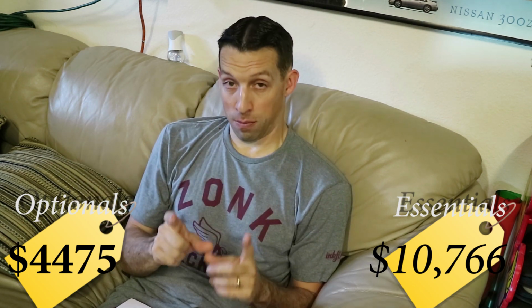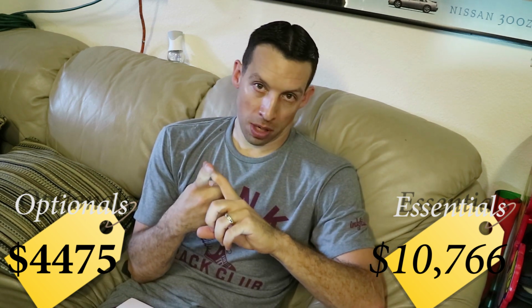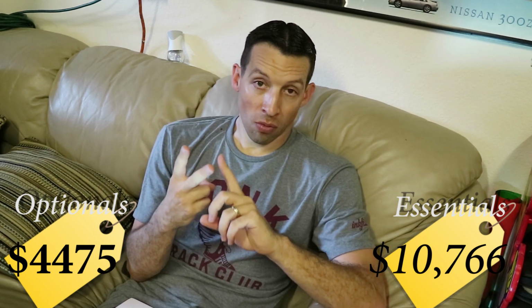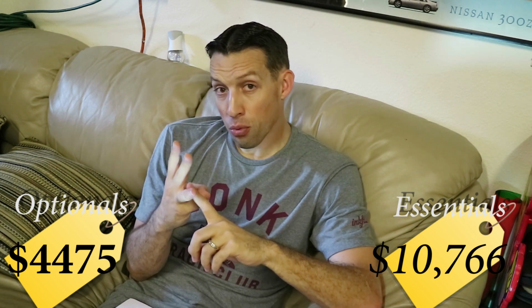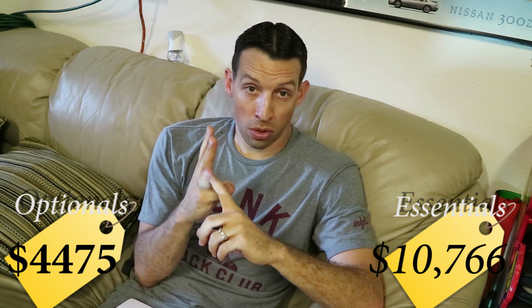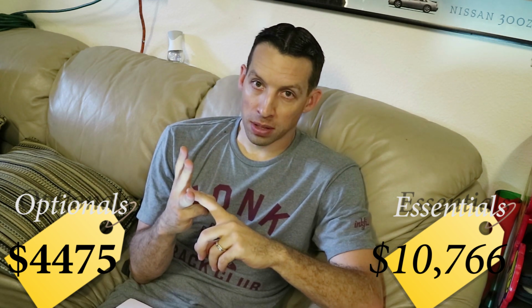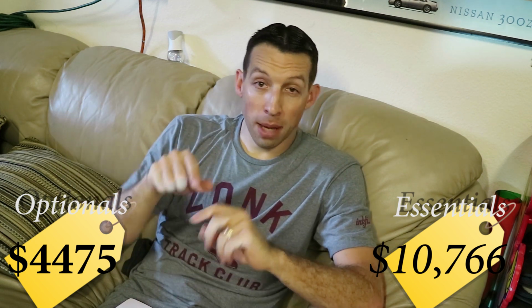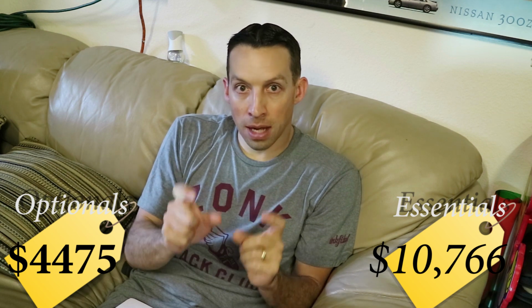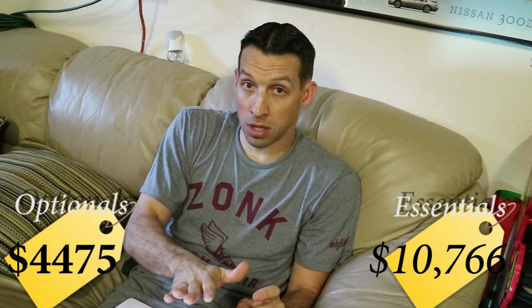There are some significant benefits in buying this harness. One, it's all brand new wiring and brand new connectors. Two, it's specifically run in such a way that you can tuck all the wiring. Number three, the PTU, the power transistor unit, also known as the igniter chip, sits on top of the RB26. And Wiring Specialties wires their harness to be able to put the PTU inside the car next to the ECU in the cabin at the feet of the passenger side.